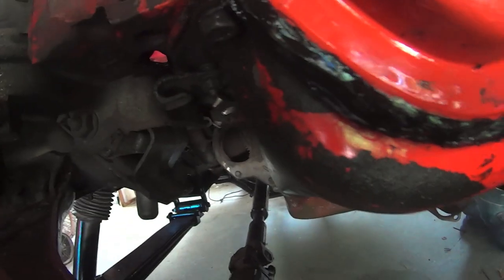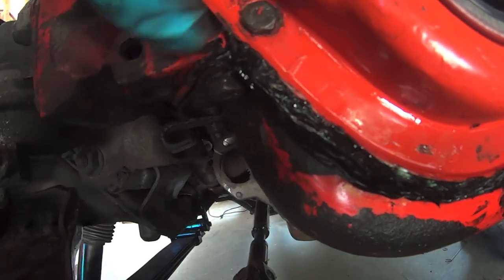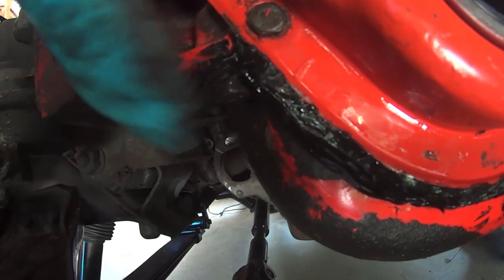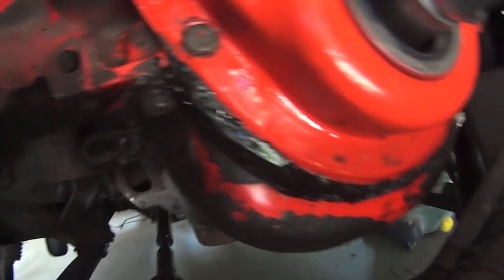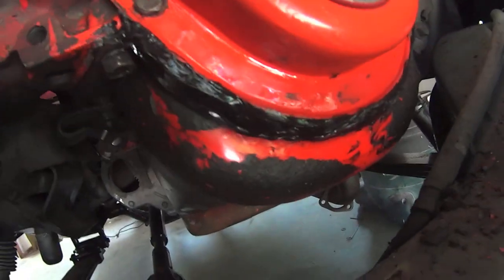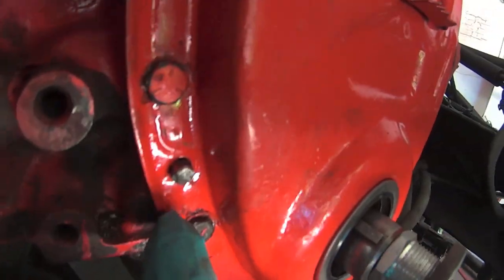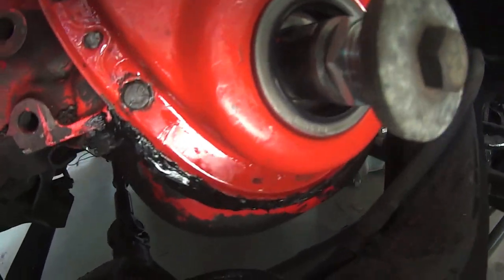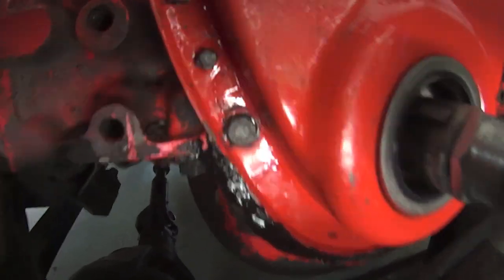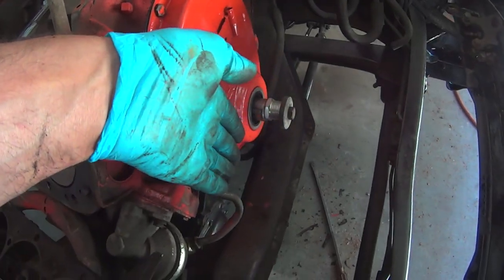Like the gasket is meant to go on. It's got a little lip — this half-moon rubber gasket — it's got a little lip that comes out here and then it fits in a little notch in the pan gasket so they mate together. But you can't obviously get at that because the pan's on, so you have to modify and pump the silicone on that edge because this is a problem area — they always leak here. You can see it's washed out. So you've got to take the locating dowels out and get longer bolts for the two bottom ones here, and pull it in slowly, keeping the rubber from popping out. Screw it in slowly, put a spacer up here so it comes in evenly.